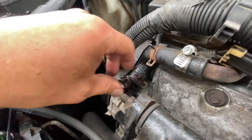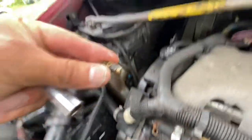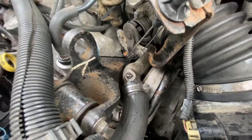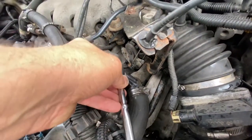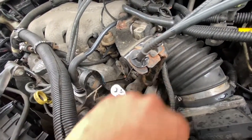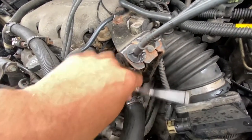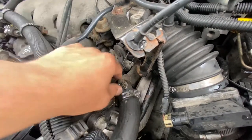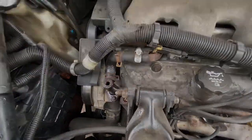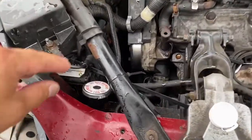Each time you go a little further. In our case I've loosened these before so they come out pretty well. You basically take them all the way out. Put them aside — same with the other one. You might even need to heat them up with a blow torch a little bit; just be careful not to light your vehicle on fire. So we've got both bleeders out.